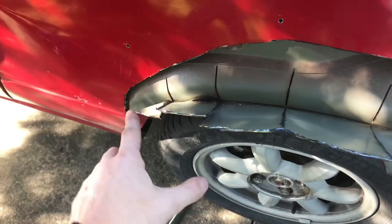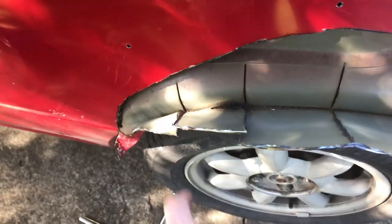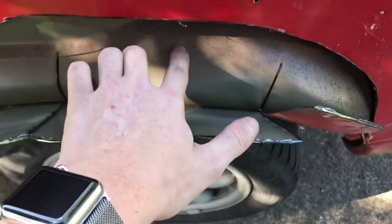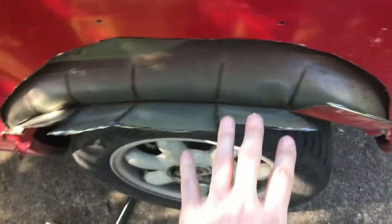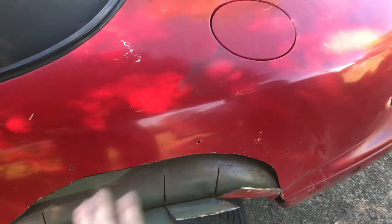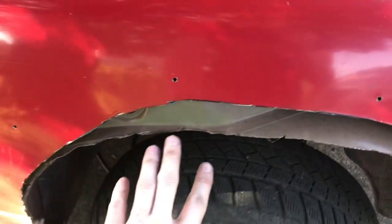As you can see, there's a secondary layer behind the first layer of the quarter panel on the outside. What I did is I just cut through both layers of it and then peeled these back. I cut lines so I can peel them back, and then these lines here I'm going to connect to those and cut all the way up here to reduce the inside of the fender. We're going to eventually have to weld in a new piece so dirt and other stuff doesn't get up there and cause the car to rust out from the inside. With it all cut out now, this little gap here, we're going to have to weld something in there once it's all said and done.